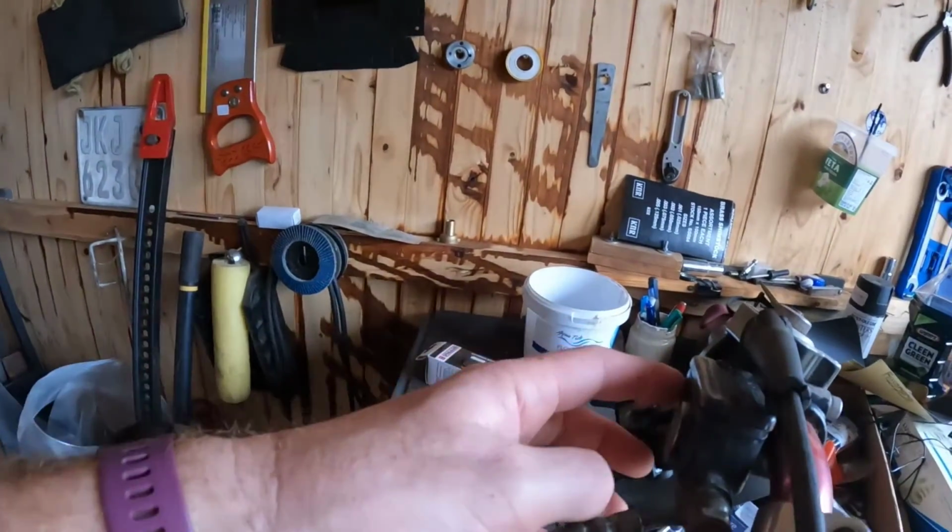Okay, so quite a lot of brake fluid went in there without anything coming out at the top. As you can see, it's dry there, so that makes me think there's a lot of air in there. So I'm going to keep doing this and see if I can get brake fluid to squirt at the top. I think I should probably clamp down the lever with a cable tie so that it's open, so the air bubbles can come out.